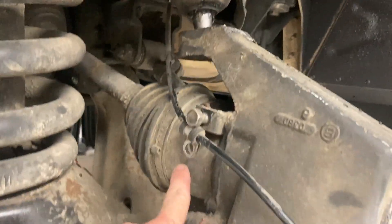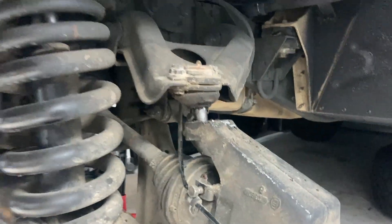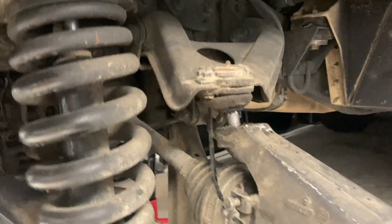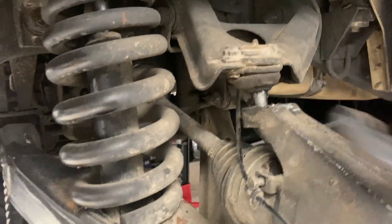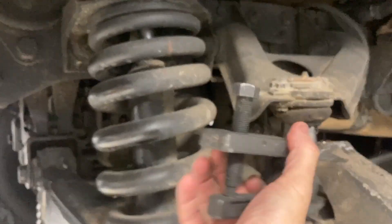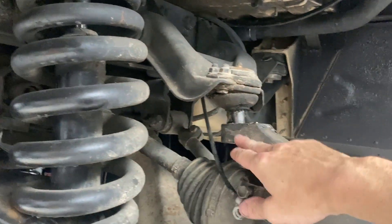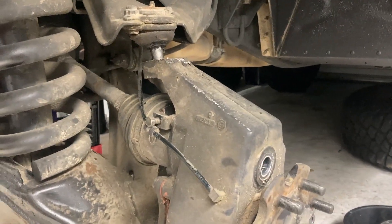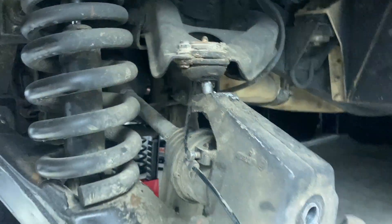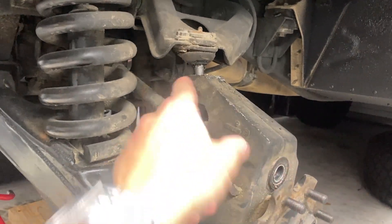This will drop out. I drained all the oil out of the portal axle and just got the U-joint separated, or the ball joint. I used a clamp to force whatever you want to call this thing into place and hold it there on the bolt head, put a lot of pressure on it. I used a torch for just a little bit - difficult because you don't want to burn up your rubber, but you can get it to wrap around the edge and put a little heat on it. It popped, so now we're on our way.